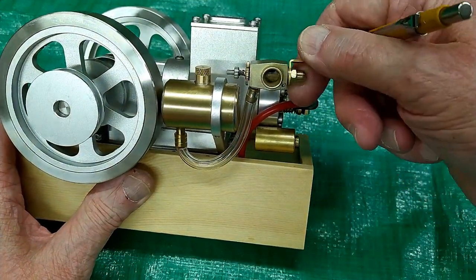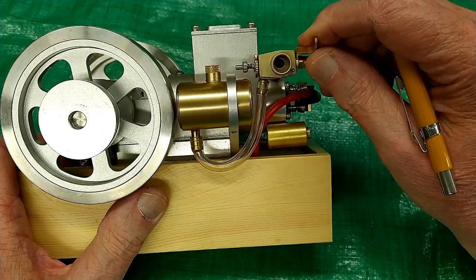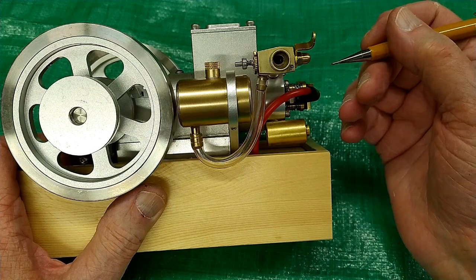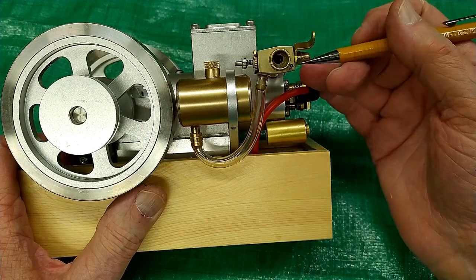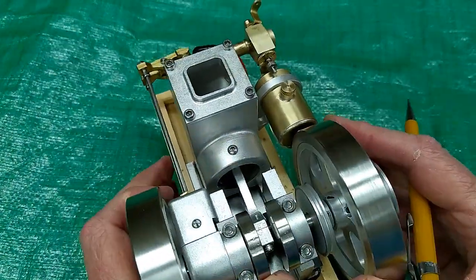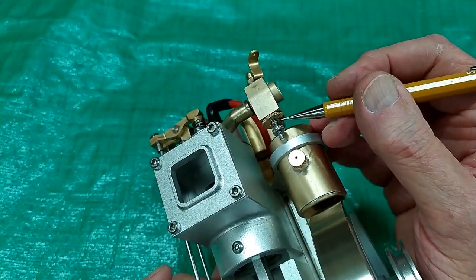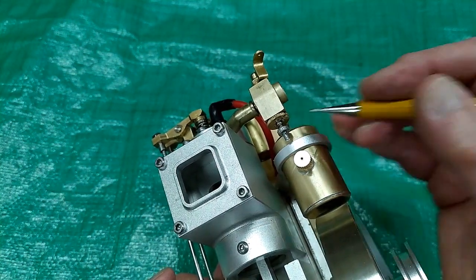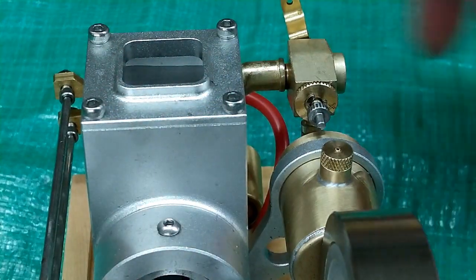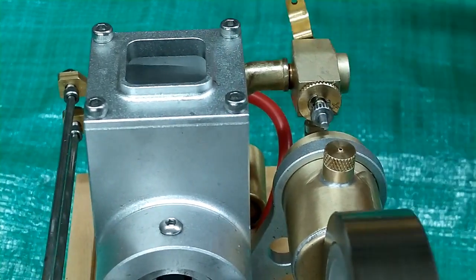That little pin limits how far the barrel can close — it's still open a little bit for idle — and that's wide open. This is one of those irreplaceable parts. This thing does vibrate, so you want to check on occasion that it's not shaking itself loose; if you lose that, you're going to have a problem. That little E-clip goes on there — those are kind of a disaster waiting to happen, so make sure it doesn't go shooting across the room. You can see how this disc wiggles back and forth when I open and close the throttle, and I think that's part of the problem.